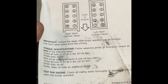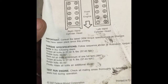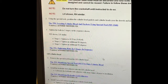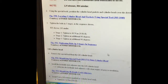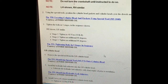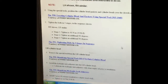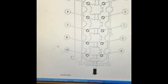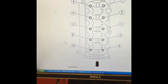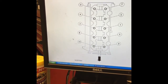This is the paper that comes with the head bolt — it kind of gives you the same thing: torque sequence and the pattern. But I'm going to show you the OEM data so you guys have a second reference. Here we have the on-demand 2008 F-150 three valve. First stage: 30 foot-pounds. Second stage: 90 degrees. Third stage: 90 degrees again. Always follow that same bolt pattern. I might be able to send you guys these diagrams. If you guys need help, just ask — hopefully I can get to your comments and send it out to you.